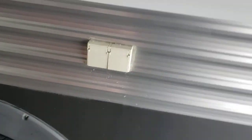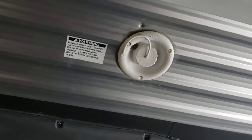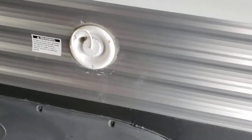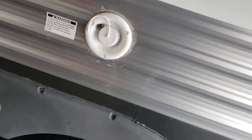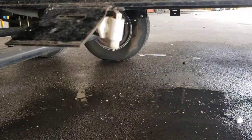Outdoor outlet — it's GFCI protected. All your GFCIs are on the same circuit, so if one trips, all the others would trip as well. Fresh water fill: if you are dry camping, you can fill the onboard tank and use your pump to run off of that tank. But if you're at a permanent spot or your site has water, you'll hook up through city water — there's no need to fill your tank. And then to drain it, there's a valve right there.